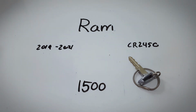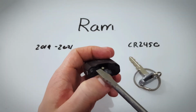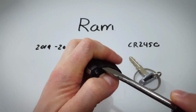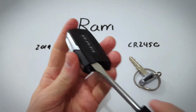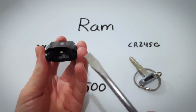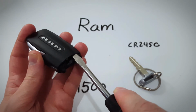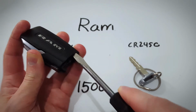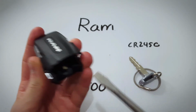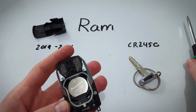You can even do it with a bigger screwdriver. It's a little more tricky. Again, we're just going to aim for this little opening where the seam is, and it's a little more risky, but you can push it in just like that, as you see, and twist. Just turn like a key, get the left side open, come into this opening now on the right side, wiggle it in, and twist. And there we go, we've removed the back piece of plastic.